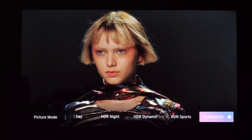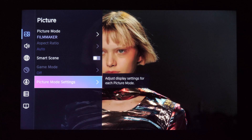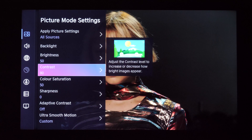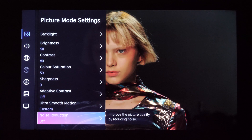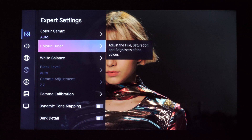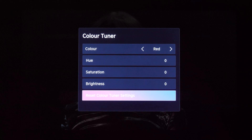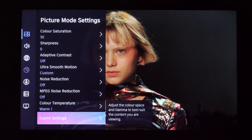So let's go back to filmmaker. Now what I will do — I will reset certain portions of adjustments to see what is causing this issue. I'll jump straight to expert settings and first we have the color tuner, which is Hisense's color management system. I did changes to basically each color except flesh tone. So now I will reset those values. And if I go back — still an issue with gradations.